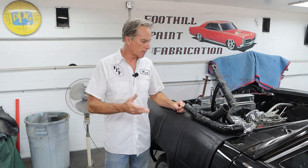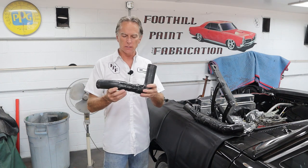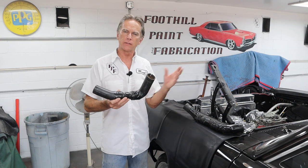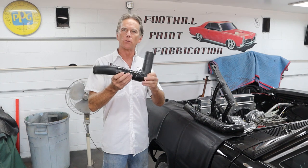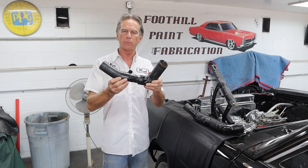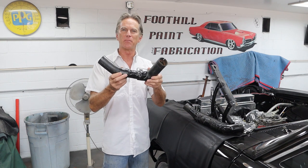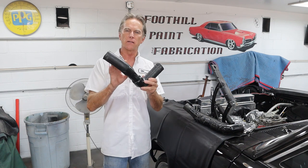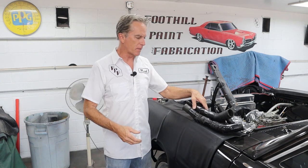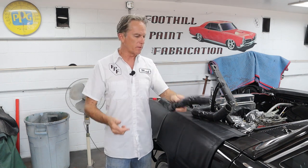I'm waiting on some parts here for the front. We also need to get some radiator hoses — the old ones didn't fit right. It's a different radiator and a totally different setup, so I took the old radiator hose, cut it in half, slipped a piece of PVC pipe in there, lengthened it, and put a bunch of Gorilla tape on there. I've got a nice little template to take to the auto parts store to find the exact custom molded hose we need. Same thing for the upper — I've got some pieces of sheet metal holding everything at the right angle and a piece of PVC pipe. I'm waiting on a couple other fittings too.